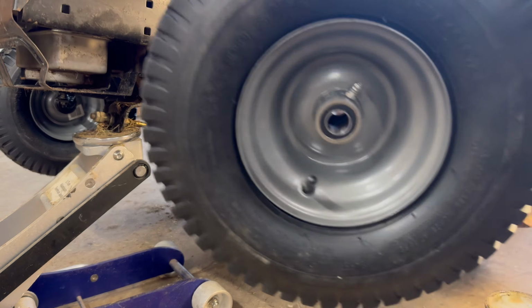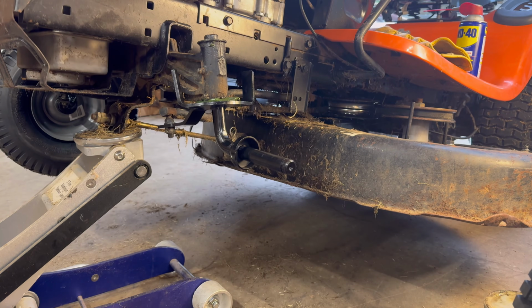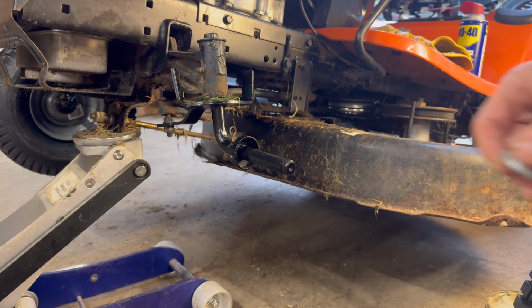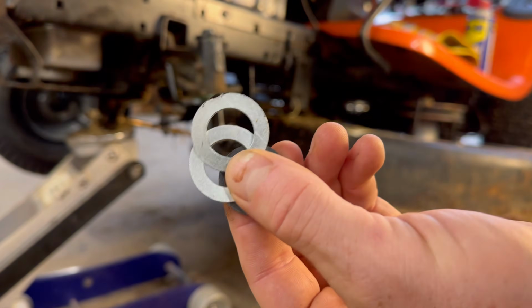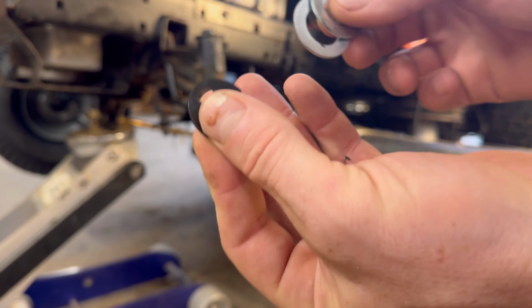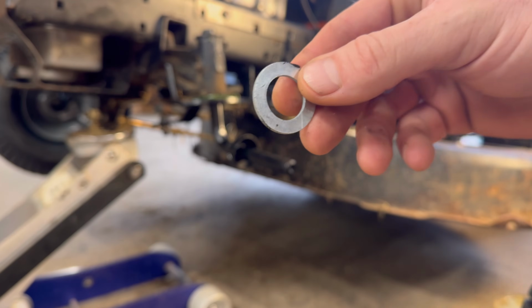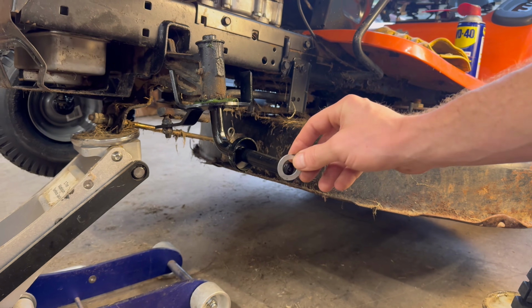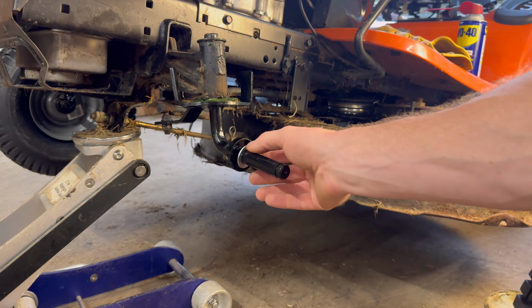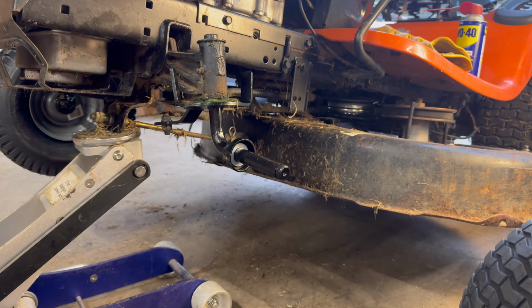Okay, mower nuts, let's go ahead and install our new wheel and tire combo on our front spindle. Now, your new wheel and tire combo does come with some new hardware. As you see right here, we've got 2 washers and a clippy. Now, before you install, you want to install the first washer on your spindle. That's going to go on the inside, slides all the way in there, and then we're going to slide on our wheel.